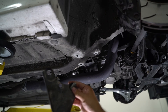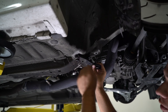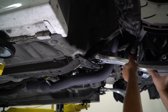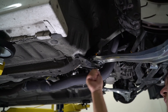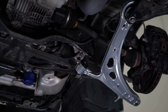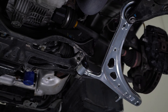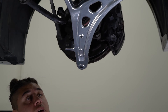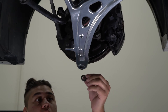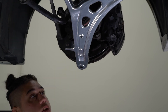We're going to start with this plate right here and the two bolts that hold it in, take it like so, and then move on to putting the actual control arm in. We're going to start on that front bushing — it's pretty easy. I'd recommend grabbing a mallet so you can tap it and just get it snug into its home. To install the remaining point of the control arm, we're going to take the castle nut, its washer, and a 3/32 by 1 inch cotter pin, and put it through the castle nut through this bolt, and we'll call it good.